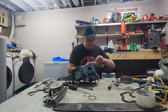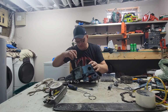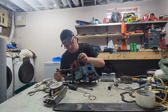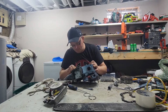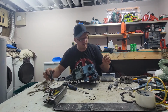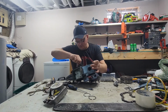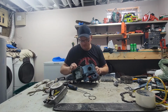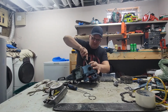That's the wrong thread. So, Homelite uses number 12 screws, which is fine, but if you're looking for replacements, that can be a challenge sometimes. At least the places I go for fasteners that we go through at work, like Edmonton Nut and Bolt and Edmonton Fasteners, they typically don't have number 12 machine screws. Why? Yeah, I think they're obsolete because they're too close to 3/16ths, I guess.